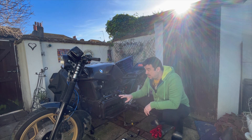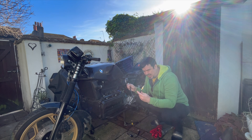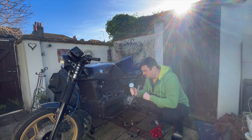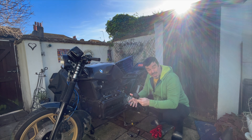I actually personally listen to it with fueling, but first of all let's just eliminate compression. To that end I have a compression gauge that's hopefully got the right screw fitting on. It's just a cheap one bought off eBay, maybe Amazon — I'll double check. It wasn't that expensive, but it should let me know at least if I've got any compression across all of them, roughly where I'm sitting. I'm not overly concerned about accuracy.